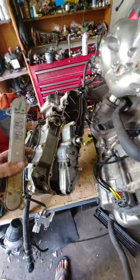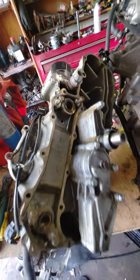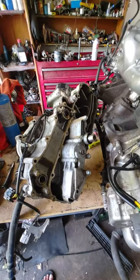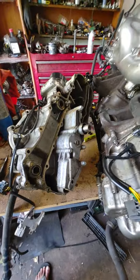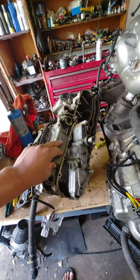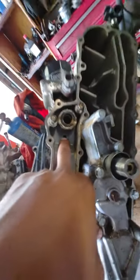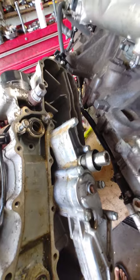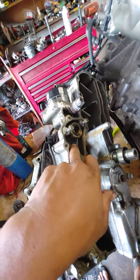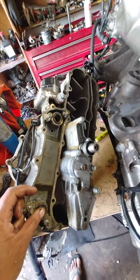There's the oil cooler — it goes right here. These O-rings are super cheap and go bad. If I replace those, that's what creates the seal for this. I just pressure test it to make sure it's good. The water passage goes in here, fills up this chamber. I actually had one engine with a crack behind here because this leads all the way through and water could seep in.